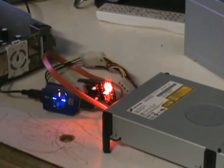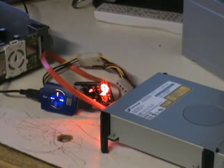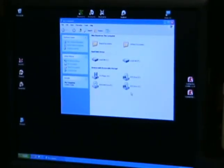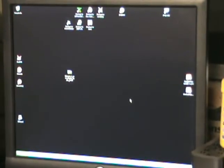Turn it on. The drive should mount into your computer. Our drive is G right here — just mounted up. You can right-click and hit eject just to make sure that is our drive. Some people restart the computer and open and close the drive tray three, four, or five times to make sure the computer mounts the drive. You can do this with the X360 USB to SATA, but I've never had to do that — it always mounts up just fine.